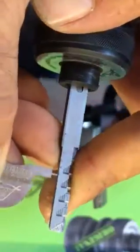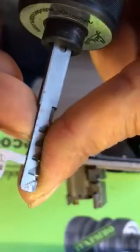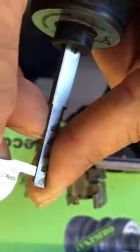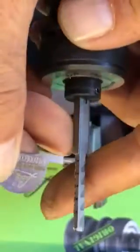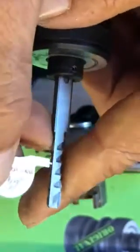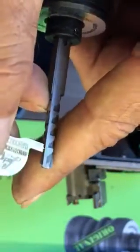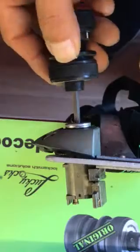Just inject the needle and push. That needle will push your pins and leave them in the start position. If you do not do that, you will never open the lock. So the reset procedure is important. Visual control, all pins, you see them in start position. Stay at the right, push at the front. Let's try again.